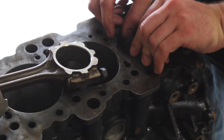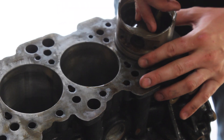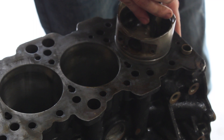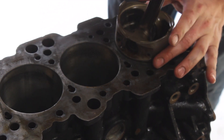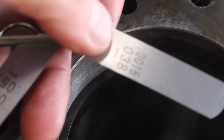I forgot to do one thing — check that the piston ring end gap clearance is correct, otherwise you'd have to shave them down. You want to use a piston and put it down into the cylinder bore, pushing the ring so that it's flat all the way around. Make sure there's enough end gap. Then use a .0015 feeler gauge on the outside of the ring to make sure that the piston wall clearance is correct.